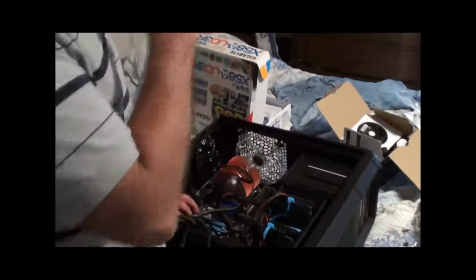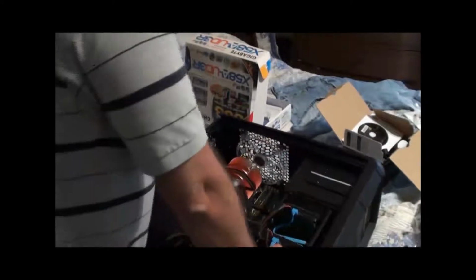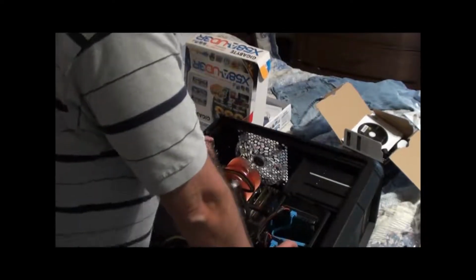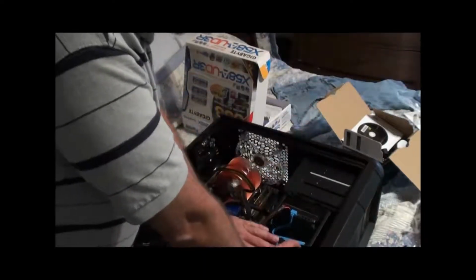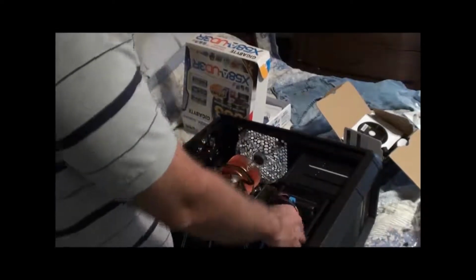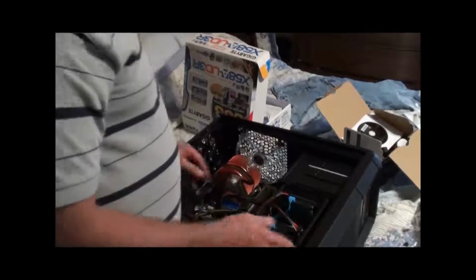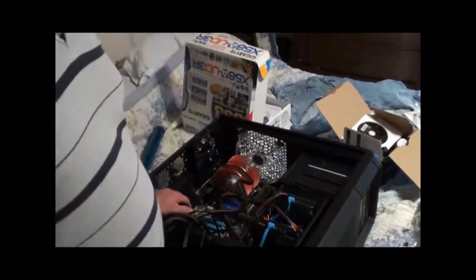All right. I've got power to the drives. I need to get a power cord to connect to the upper removable media drives. I had a problem with the power cords. One of my hard drives is a Western Digital, the other is Seagate. For some reason they flip-flop the power connector, so I have to put a twist in the power cable to get it to connect to the 2 drives properly. That doesn't make me happy, but it's the way life is. My other hard drive that's going to come in here is also Western Digital, so I can already see some fun with that. Be back in a minute. I'm going to go get the power cords.